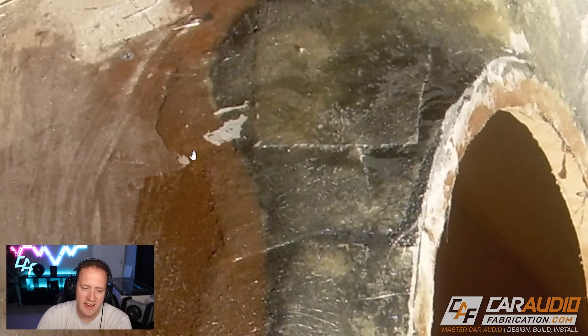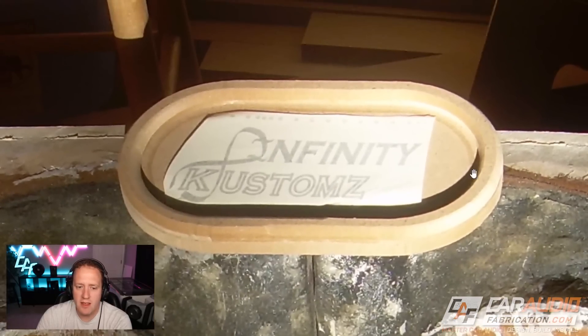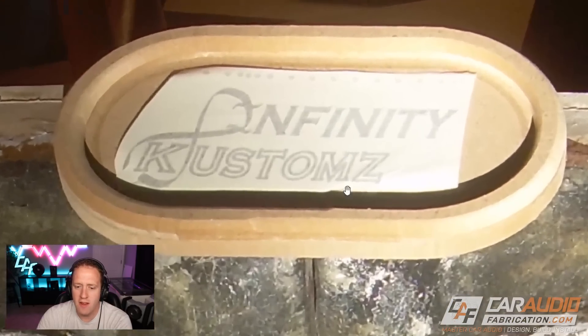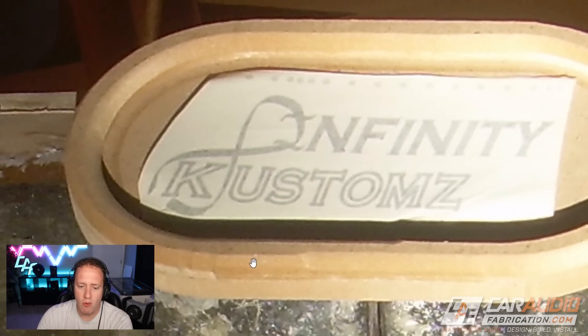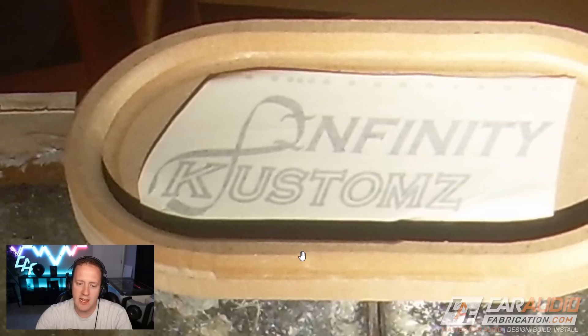You can really see how I just laid these fiberglass chop mat pieces on top of here — what a pain to have to try to match all that up perfectly when I could have just sunk that edge down with a rabbiting bit and kept it nice and flush. In this picture it looks like I started laying out my little beauty panel that I was going to have down below between the subwoofers — made with the router. But this is a common mistake when people are new to using a router: you have to make sure you always have firm pressure pushing down on the work piece as you're running it through the router table. I can tell that I didn't have firm pressure because I can see some chatter marks on the chamfer.